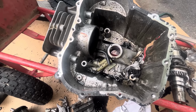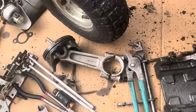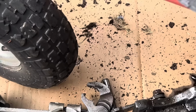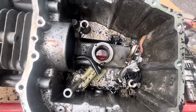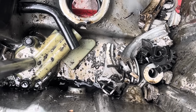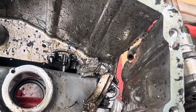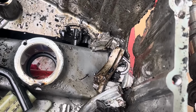So, believe it or not, the connecting rod was good. Connecting rod was still connected. Good ends too to the connecting rod. But what blew this one up was actually the synchro balancer. See? Those are the links to it. Catastrophic damage, just completely disintegrated, and blew out the back. The balancer just was so heavy and it came off and just knocked it right through there.